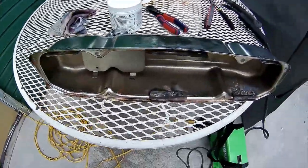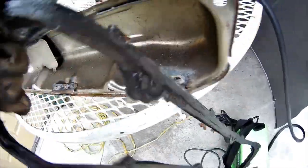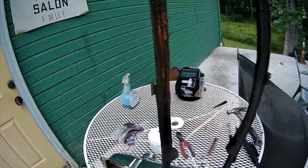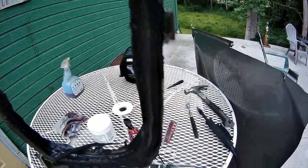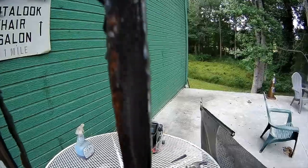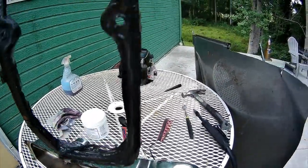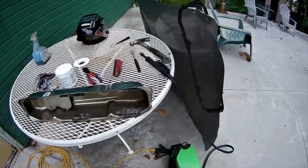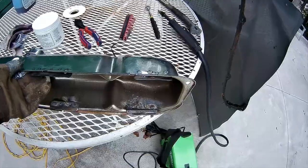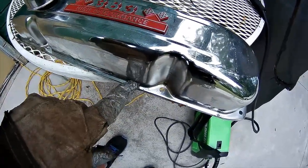The gap there might be a little bit too thin for that gasket. This gasket between those two bolt holes is about an eighth of an inch thicker than between here and here — and that's one of the problems, the reason why the gasket moves. Nothing you can do about that. Maybe somebody knows a better way — please comment below. The best way I know is just to avoid these inexpensive aftermarket overseas valve covers altogether, because they will not seal. This flange is just not enough.